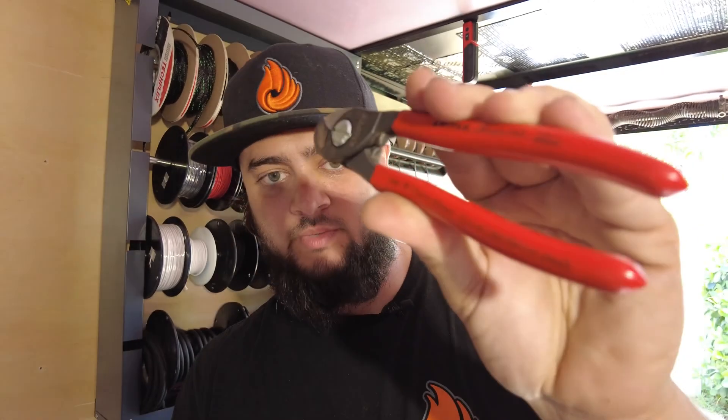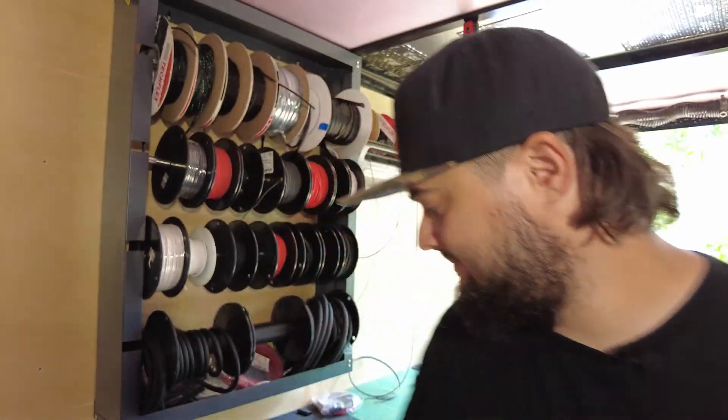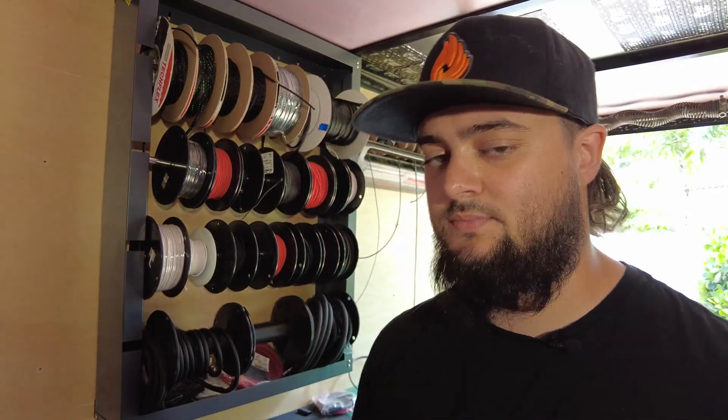I think I'm on my second set of these — I make tens of thousands of wire cuts a year. These are meant for copper and tin-coated copper, and aluminum wire. They even say on them: do not cut steel. It's the Knipex 9511165, made in Germany — love these things, super high quality. Surprisingly enough, that's all the tools you really need for battery cable: cutters, crimpers, and for the tech flex you need scissors and a torch. For the heat shrink it's recommended you use a heat gun.